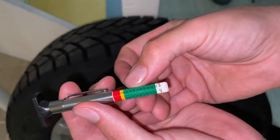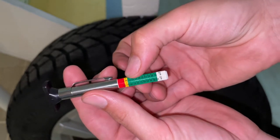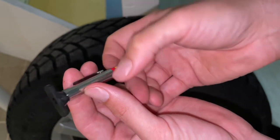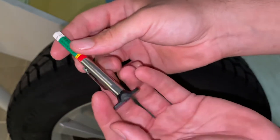If you pull a little further there's a yellow and a red line. Yellow indicates they're okay but need to be replaced soon. Red indicates — as you can see the needle's all the way in — that there's no tread and it needs to be replaced immediately.